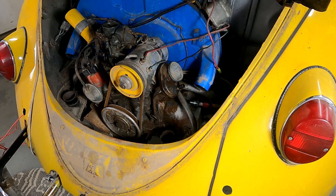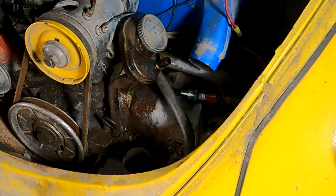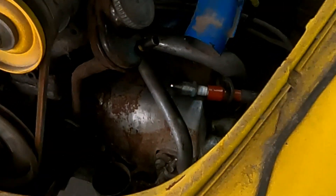We needed to make sure the coil and distributor was producing voltage for the spark plugs. Normally I would do this with spark testing, but it was not in stock, so we decided to use an old-fashioned method. If you ground the spark plug, connect a wire, and then turn the engine over, you can see the spark from the spark plug. With that working, we reinstalled the spark plug and moved on to start the engine.